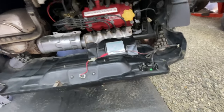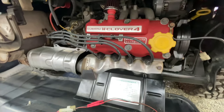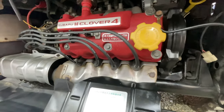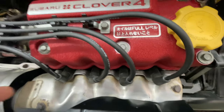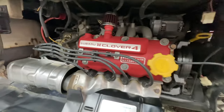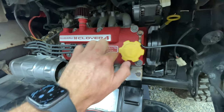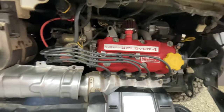I just changed the oil on it yesterday. Basically what you're gonna want to do is check everything — see what kind of leaks you've got going on, maybe there's no leaks, maybe it's dry. This one actually had some leaking above the spark plugs because the valve cover sits almost horizontal and leaks at that point, so I had to do a valve cover gasket. I've got a red valve cover cap, new oil caps, and old drain plugs for sale. Give it a look over and see what you're working with.